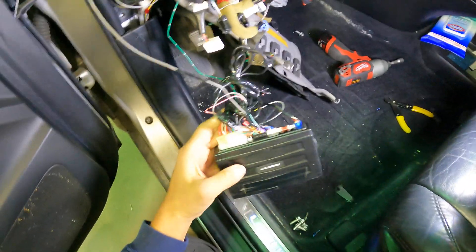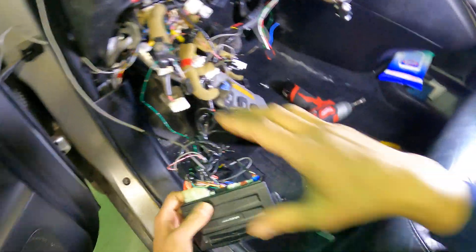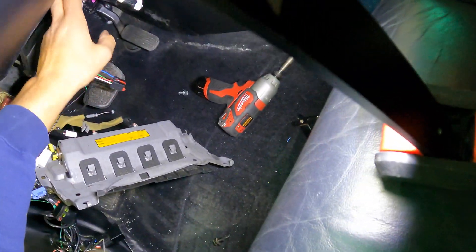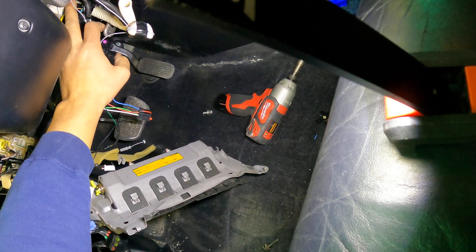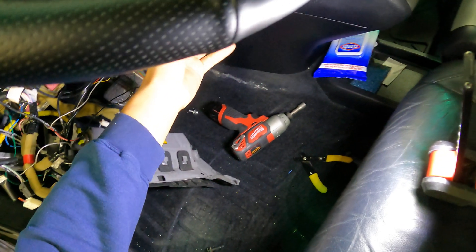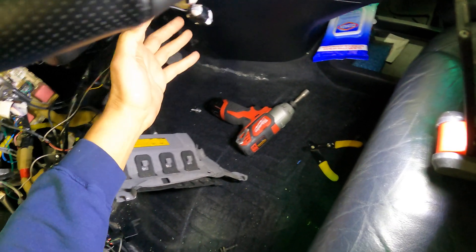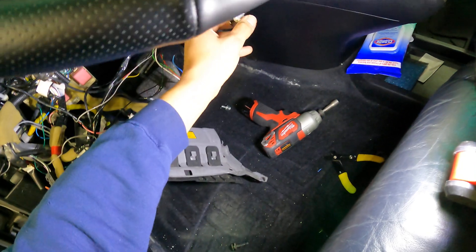The first thing we've seen is the remote starter installation, and we also have a dash cam installed in here. The remote starter is not to our liking — there's a lot of exposed wire, a lot of wires that got butchered. The connections to the ignition connector are very close to the actual connector, which means if any of the wires break it would be very difficult to fix. Instead of using a proper interface bypass module, they used one of the vehicle chips removed from one of the keys with a relay system. It can work, but in a car like that with an interface module, it's preferable to use that interface — it works much better, much cleaner.